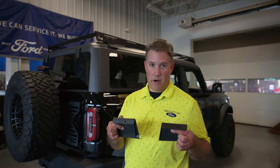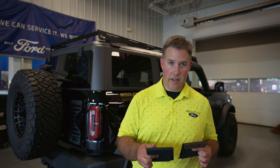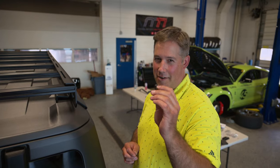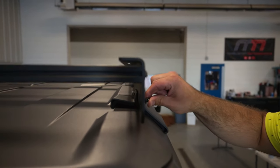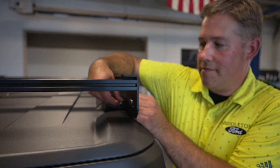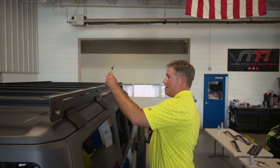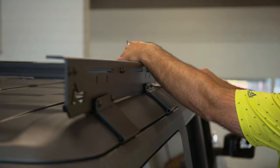The next part is actually mounting the rear part of the roof rack. Double arrows face the rear — those are the far most back brackets. The single arrow ones are the front brackets and they face towards the front of the vehicle. We need a 1-inch bolt, black oxide washer, and a locking nut. Slide it through the outer bracket, through the rack, and then line it up on the inner one. Hold that tight and you should be able to start the nut on the other side. Then we're going to do this with the rest of the remaining brackets. I'm holding the inside nut with a wrench here.